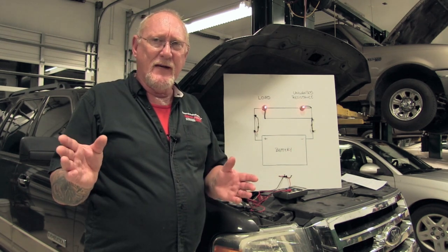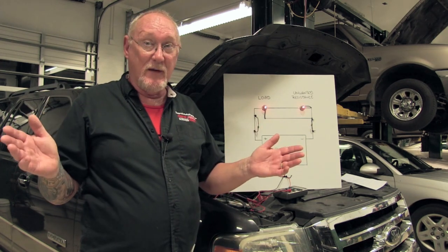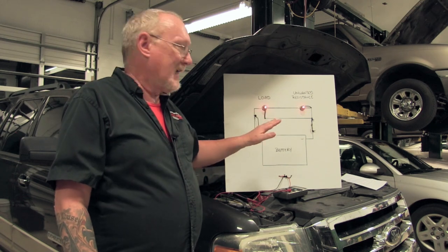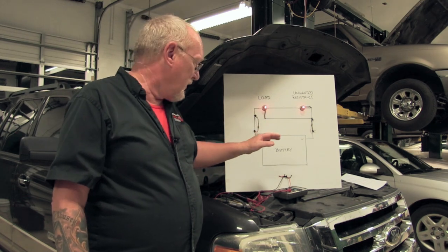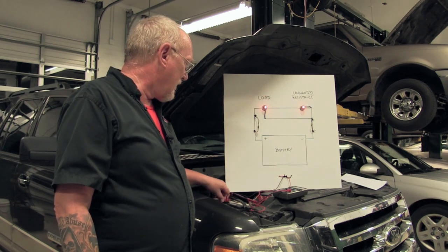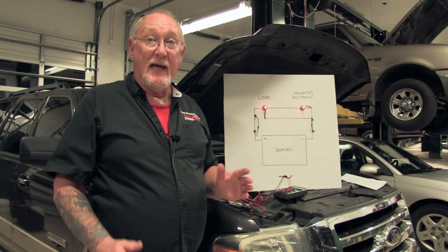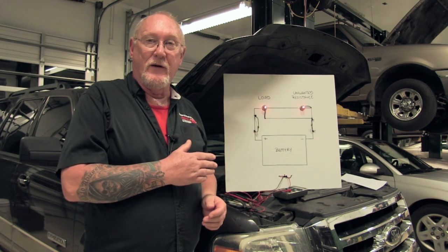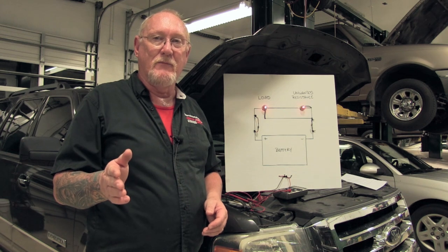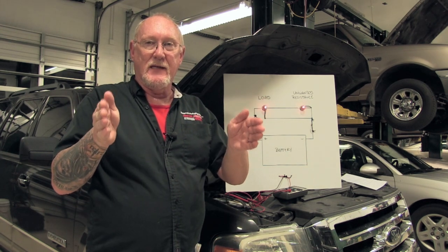Let me just say it quickly: if you find a problem related to voltage drop, it's not going to be a matter of a few tenths — it's going to be big. You'll see it. When you're going to test the negative side of the circuit, all we have to do is move the negative meter lead over to the negative battery post, and then use the same positive meter lead as our test probe and move it to the ground side. Again, just like we showed you in the November video — if you see a number there, that's a flag. That means there's a problem on the ground side, right between those two test leads.